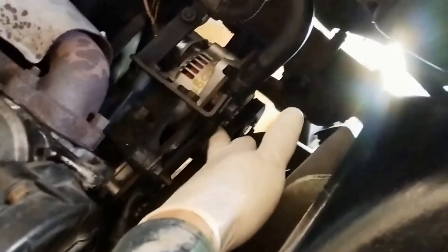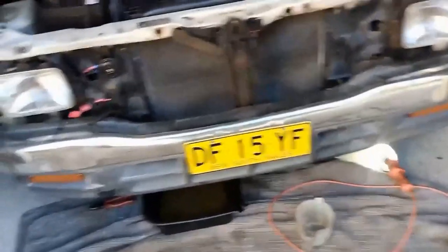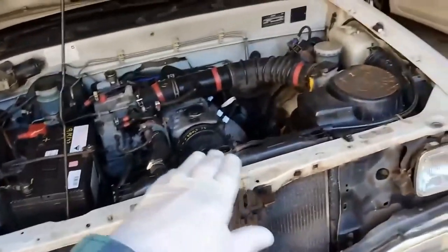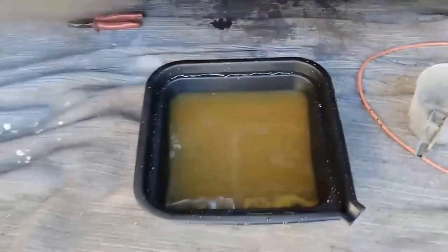What I can report after one week: the alternator belt had to be adjusted because it got some slack in it. Now I've drained the water - I use this radiator and battery solution, and I put some rust inhibitor in it. When there's no water in the system and it's probably an iron block, it does rust out. So it's definitely a good idea to give it a flush, and now I'll put the coolant in.